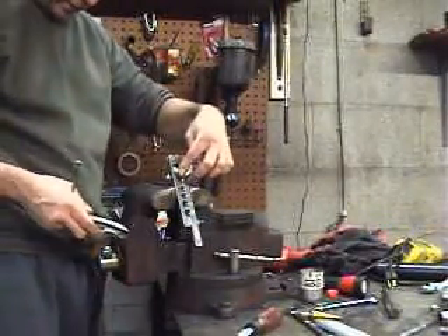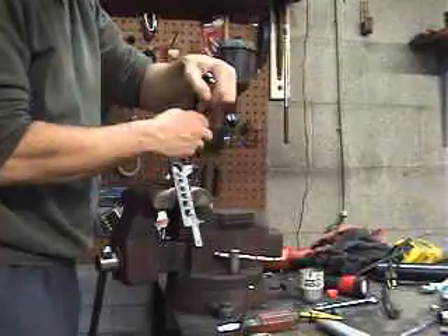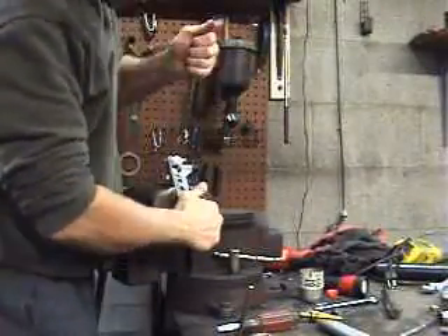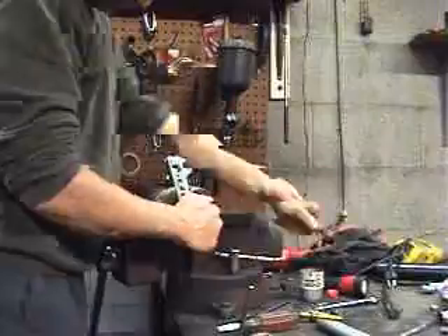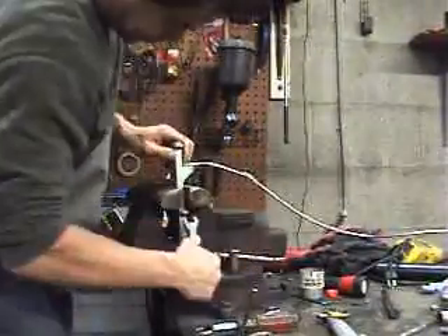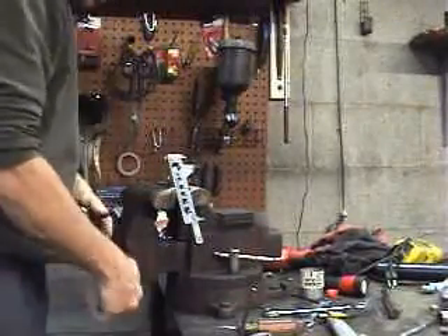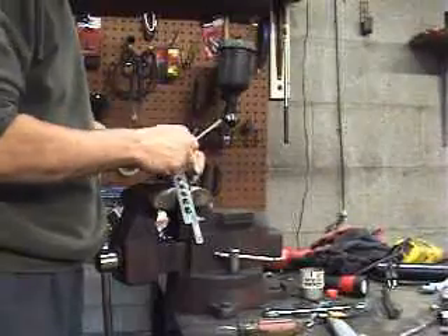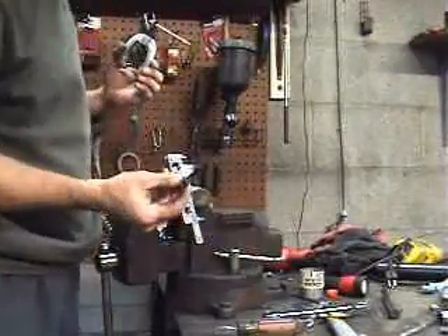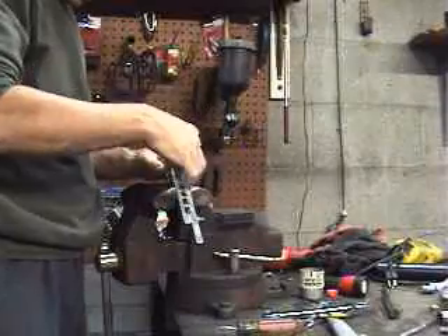Actually, I don't think it's sticking out enough. I want that sticking out a little more. Let's see if I can get lucky and shove the tubing through — I was turning the nut the wrong way. There it is. Make sure my vise can go over this good. Yep, find my little double flaring bit — there it is again. Like I said, it goes in the hole. Okay, we're sticking out a little more now.